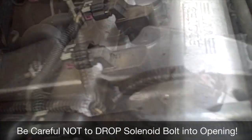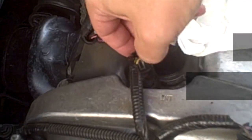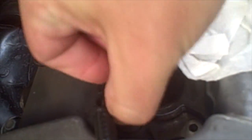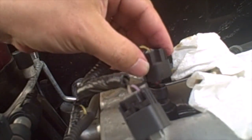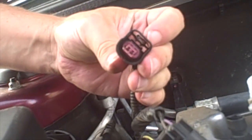They do have some oil in them. While we have the intake solenoid valve out, we are going to go ahead and loosen up the exhaust valve solenoid — we may need some clearance to extract that one with the channel locks. So we are going to remove the connector. Be gentle with these cables as they are kind of brittle from the heat. This one is giving a little bit of trouble coming off — I had to push down on it a little bit in order to free the little grab there.